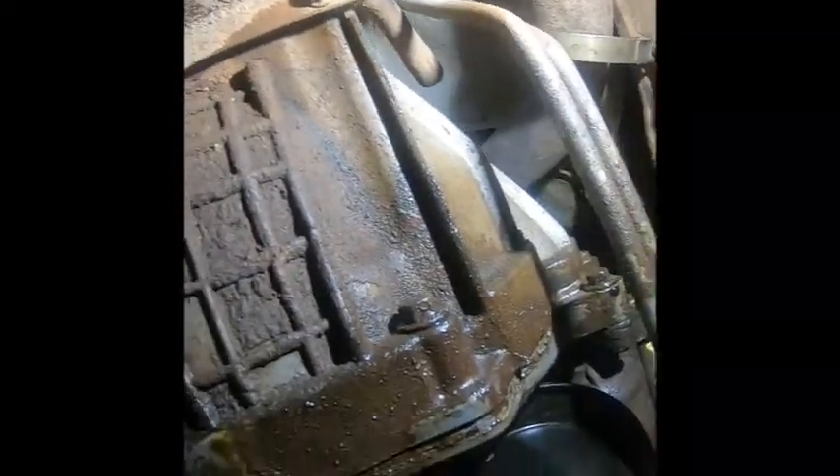We've got one, two, three, four, five, six, and then there's seven, eight — I think it's nine total, eight or nine. These are all 13 millimeter. It's a little tight under here with a camera. I'll also be pulling these four bolts over here on the motor mounts — also 13 millimeter. I'll let you guys know the exact numbers of what I've done.